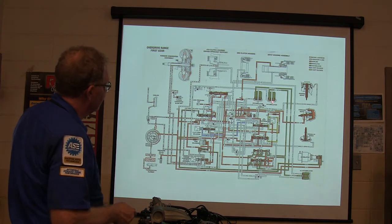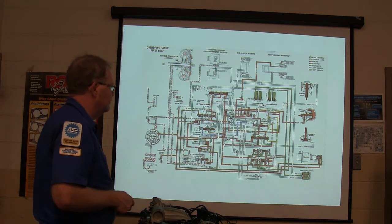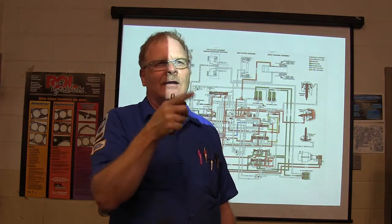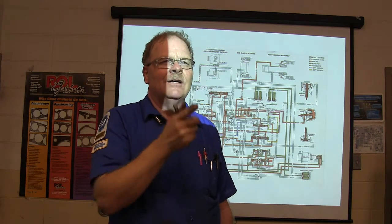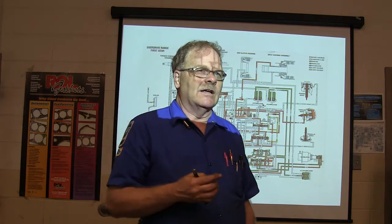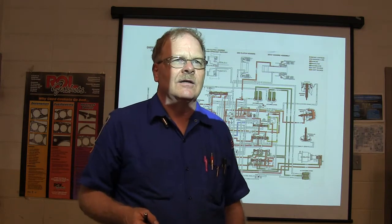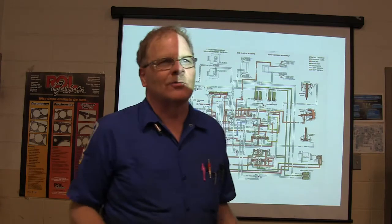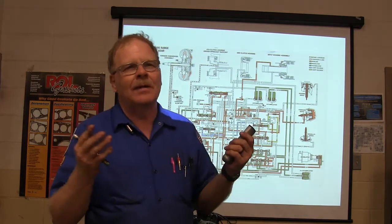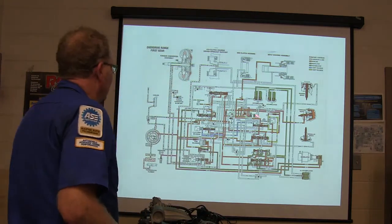So basically you got accumulators here. Accumulators are basically like little cushions that soften the application of a clutch. Remember yesterday, when he had forgotten to plug the output shaft sensor in on the Tahoe we were driving, it knew the vehicle was moving but had no vehicle speed signal. So it jerked a crick in our neck, boom, because the pressures went really high. It raises the pressures really high so it'll apply the clutches really hard, so it won't slip them and burn them out. So if you've got a really harsh apply, that's why, anyway.